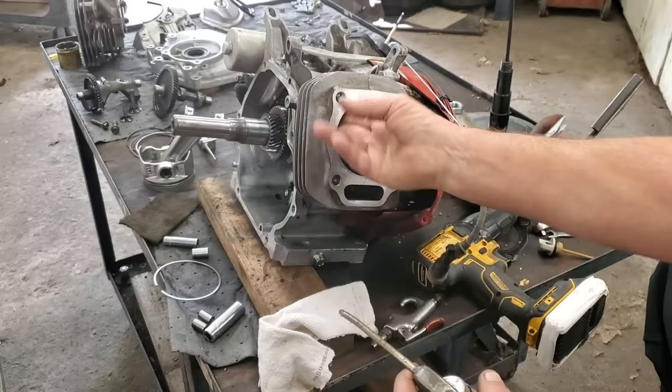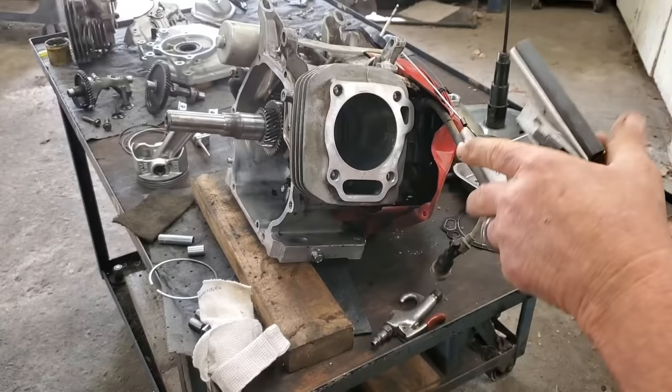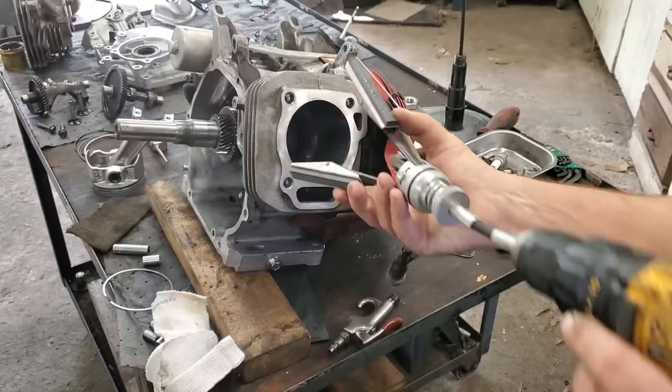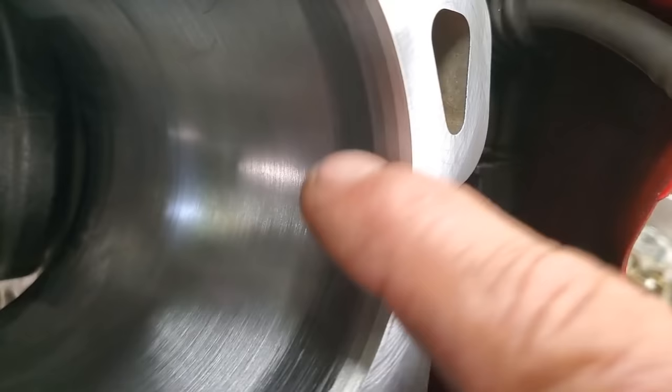Let's take a little oil and go inside here. This tool I'm fixing to show you is an old automotive tool — because I don't have a proper one that will fit this — these are just stones and you're going to put them on the drill and run it in reverse. Feels nice. It looks much better now — no ridge at all, it's smooth. A little bit of discoloration there but I didn't want to go too much on this thing.